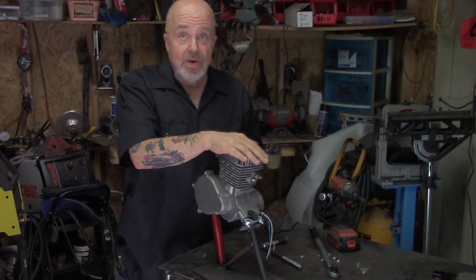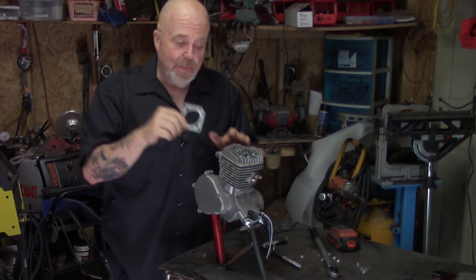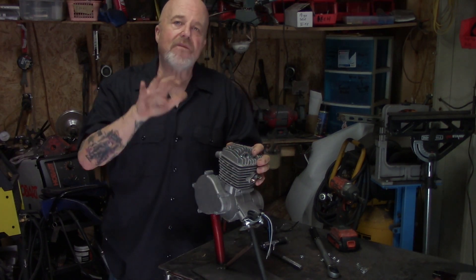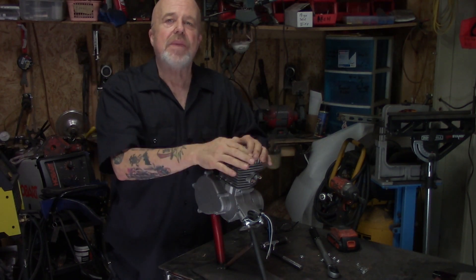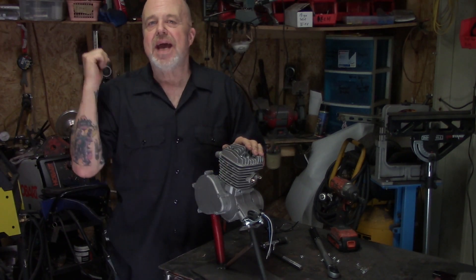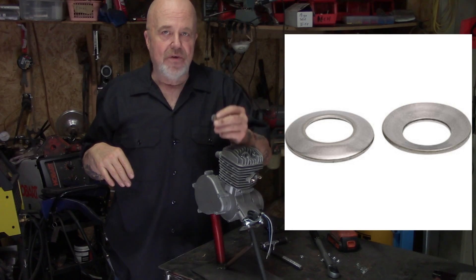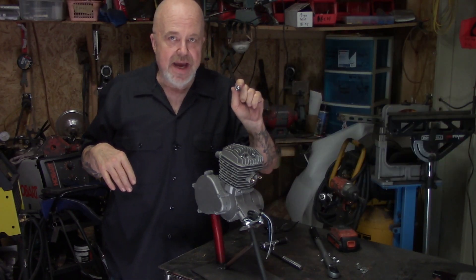You think, 'I don't want this thing blowing gaskets, I'm going to crank it as hard as I can.' No, don't — that's adding to the problem. So after breaking in your engine after a rebuild or brand new engine, after four or five warm-up cycles, you want to re-torque the head. I recommend you ditch the acorn nuts and the washers on the head and get some Belleville spring washers and standard eight millimeter hex nuts.